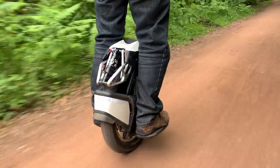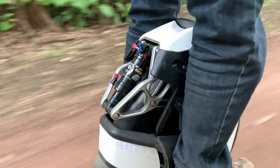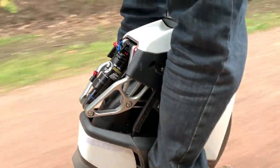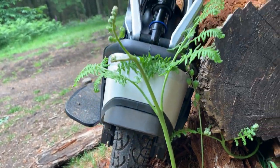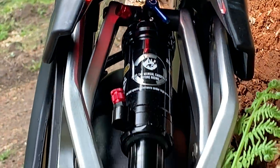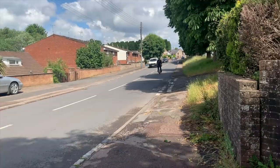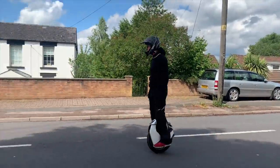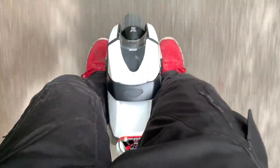Be very wary of that if you're used to riding wheels and you go off down the road and slam the brakes on in an emergency - you're going to get massive tank slap, as we call it on motorbikes. Trial it out in a clear, non-dangerous environment. To handle it: bring your legs inward, twisting them in slightly, and clamp that wheel under heavy braking. Get your weight back as far as possible by crouching, and you dominate that machine so it doesn't wobble between your legs. I've noticed you don't get this anywhere near as bad if you're braking on a corner - because you're leaning in, your leg is touching the side and braces it to a degree.